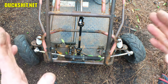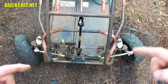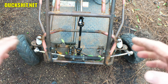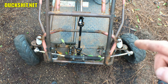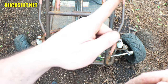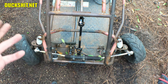That little difference may be subtle, but it's going to make a huge difference in how this thing steers. Before, both wheels steered equally, and in a turn all four wheels would fight with each other — the rear axle is solid with no differential, and the two front wheels were fighting each other as well. So steering was just a suggestion. The best way to get the thing to steer was to get it up on three wheels. By stiffening the rear suspension with motorcycle shocks and loosening the front with softer shocks, the outside wheel compresses and lifts the rear wheel on the opposite side, giving a little three-wheel action in a throttle-on turn — essentially the go-kart technique.